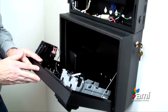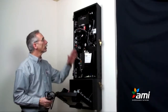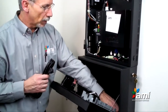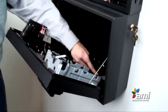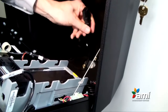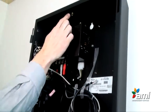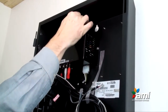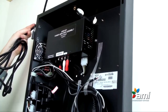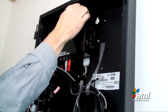At this point we're ready to determine where the power wire is going to come into our jukebox. The power wire can either come in from the bottom or through the top. In both cases there's mouse hole access — in the bottom of the currency module there's a mouse hole we can pass our power cord up into, or if you want to bring power in from the top of the jukebox, there's another mouse hole up here that you can open up and pass a power cord or speaker wires through.